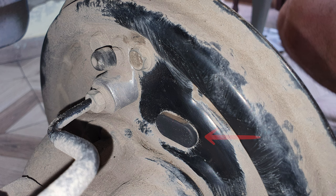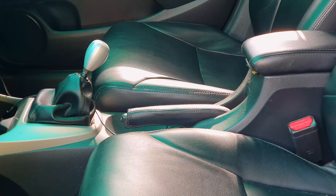The backplate of the brake drum has an access port through a rubber seal where your screwdriver can fit, allowing you to turn the adjustment screw without ever taking the tire off. However, it's quite hard to access and would be easier on a lift. The rear drum brakes are adjusted and the handbrake will also be tighter.